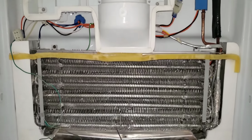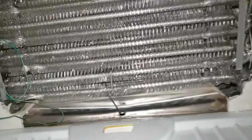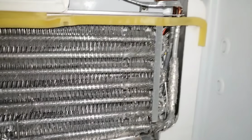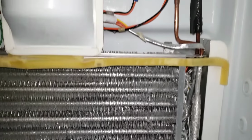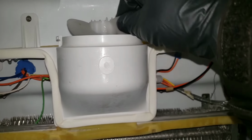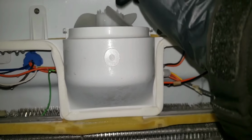First observation, upon taking the back panel off of the evaporator, the defrost heater is on and operating. Verifies the defrost thermostat checks good. Heater checks good. No obvious obstruction on fan. Rotation not hitting the sides of the housing.